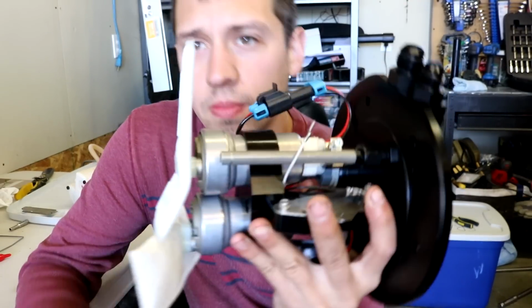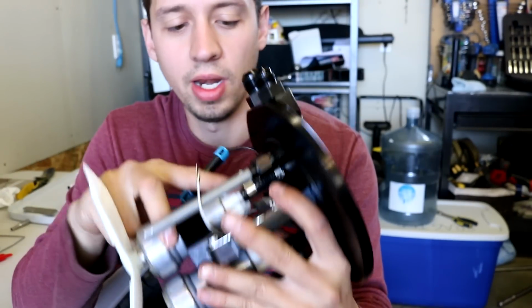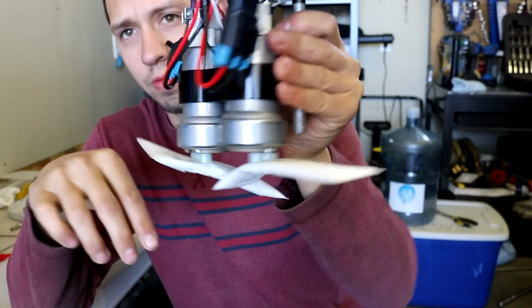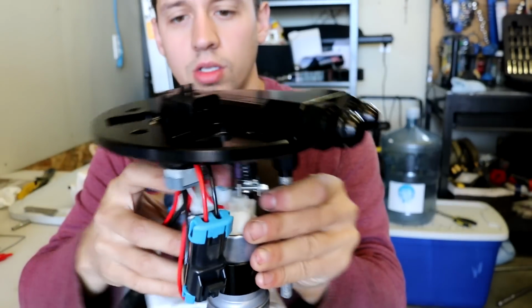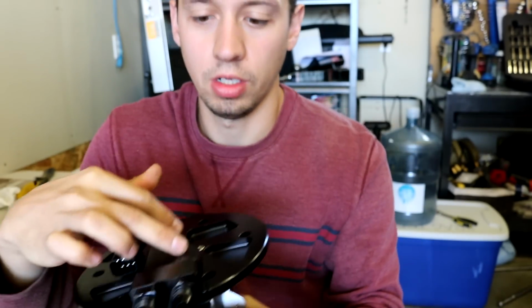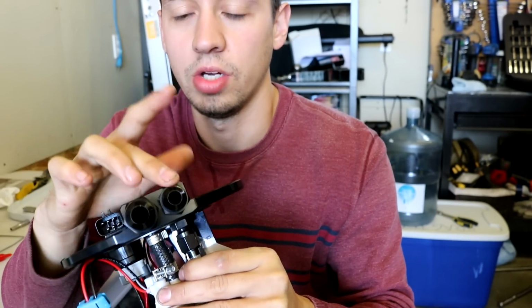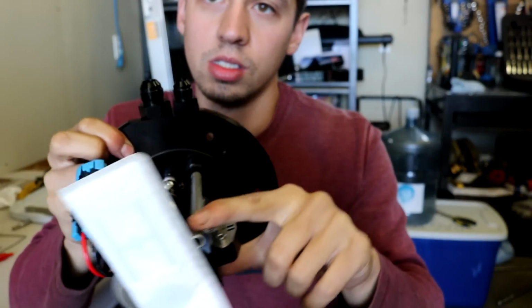Alright, so I got the pump hanger installed. These were a real pain in the ass to push in. This is how it sits. Two 450s, so they both go into a manifold right here, and they go off to this dash 10 feed. And then it's a dash 8 return, which leads back to this line right here.